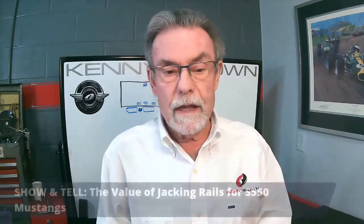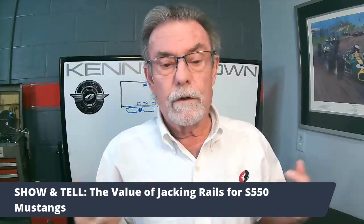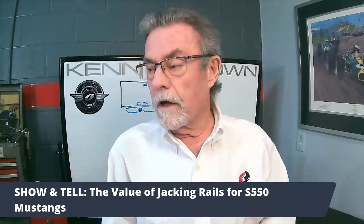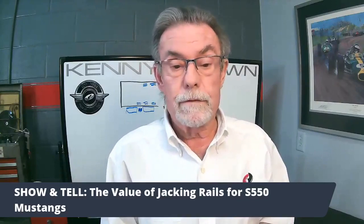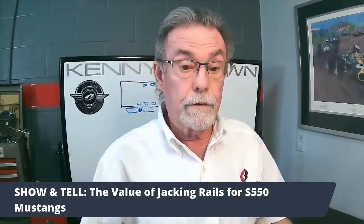So you get a really strong place. You can jack up the car. You can put jack stands under there. To me, the whole concept of jacking up on the pinch weld or putting jack stands on a pinch weld, that's not a good idea. So hopefully that'll dispel some myths about whether or not to use jacking rails in a 550. Absolutely. Your life will be so much easier with jacking rails than without.